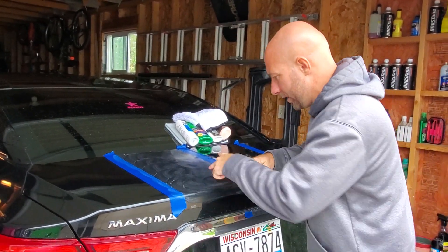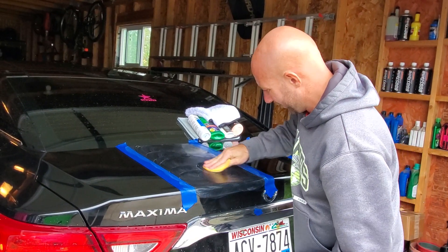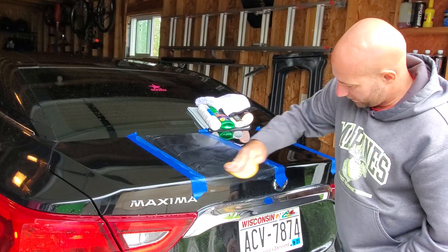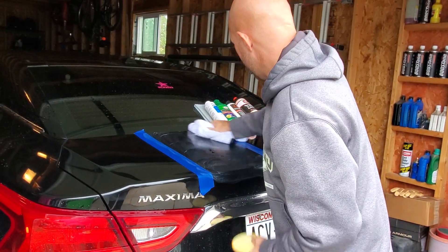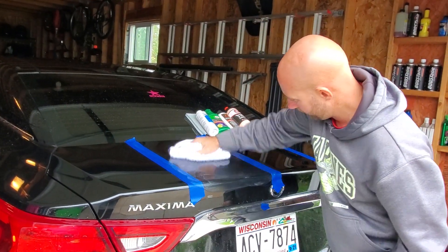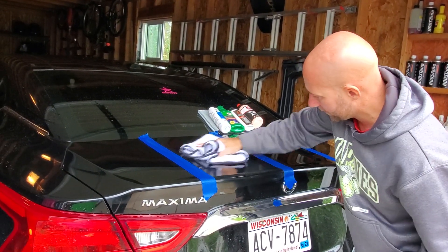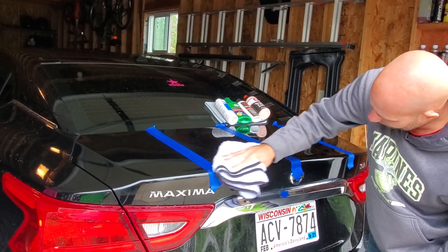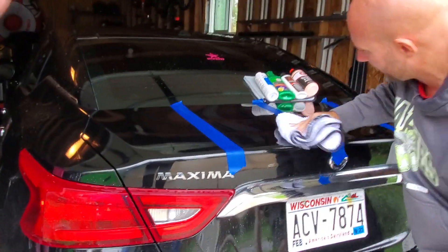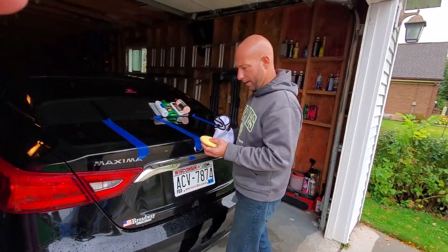We have this buffed to a haze now. Right in here we had what was a very dark white-looking scratch. I can see a little bit of it here as I'm buffing — we'll see how much of that came out. If it's completely through the clear coat, obviously a scratch remover isn't going to do a whole lot for it. Let's buff this haze off. I can definitely see a difference — that is lightened up, it is not completely gone. I feel like we have still a pretty good scuff right there. I'm going to hit that one more time and then we'll come back.